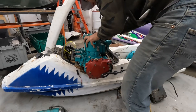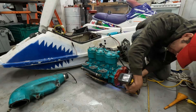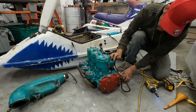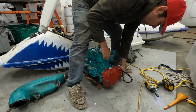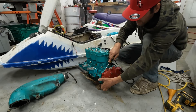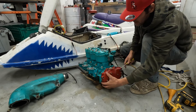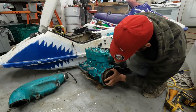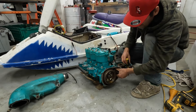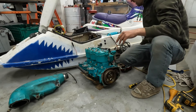It looks like I did in fact disconnect everything. Place your bets in the comments below — minor problem or major seizure? As I've already stated, my guess is major seizure. Oh, there's water in there — a substantial amount of water. I'm guessing that the crank bearing seized. I was right — that engine is stuck. It has nothing to do with the Bendix; the Bendix is engaged because it tried to start and it couldn't.